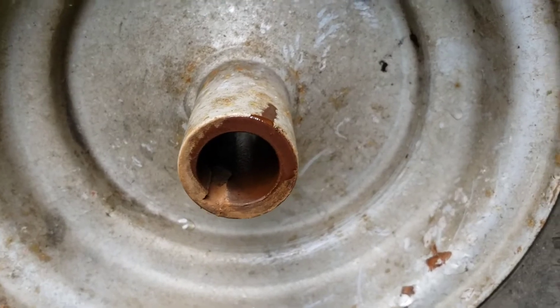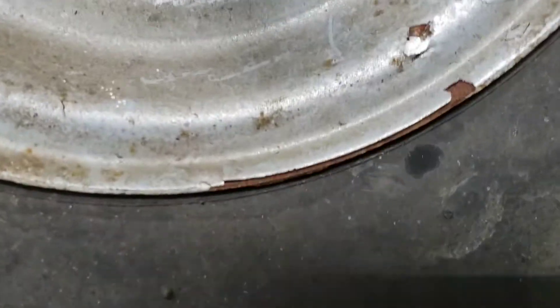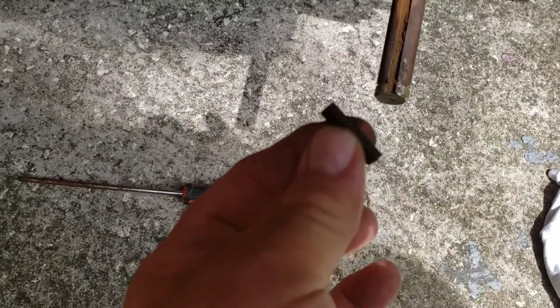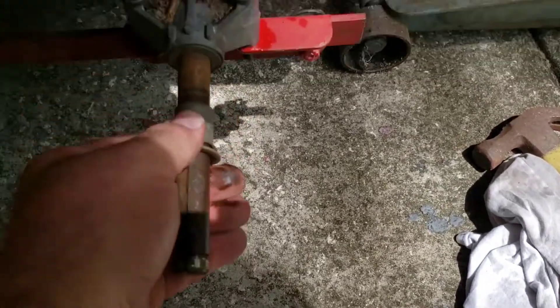I'm just going to knock that out — I don't know if you can see it in there, the little rectangular key, it's just down there a little bit. So that's the little key I was telling you about. It kind of slides in through here — look at all that dust. It just slides in there, and when you put the tire back on, that assists it staying on. Locks it on with the washers and the retaining clip.